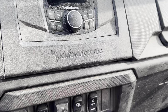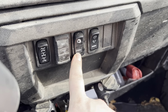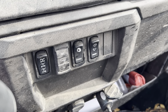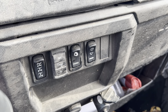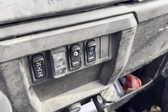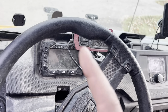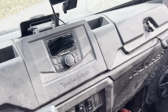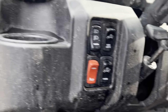I also wanted to point out this button here — it's actually an accessory button. While it does say it turns my stereo on, what I did is wire it straight to the back of the bus bar under the hood, so anything plugged into the bus bar turns on when I push that button. Everything else turns on without having the dash and ECM power up, which is kind of cool — so you can listen to music or have your lights on when stopped.